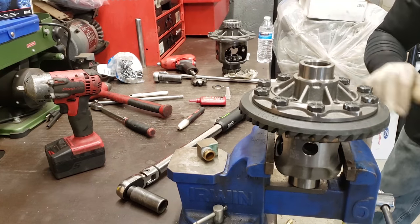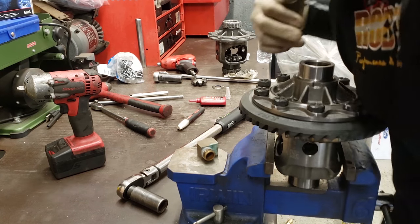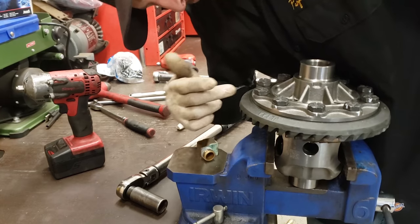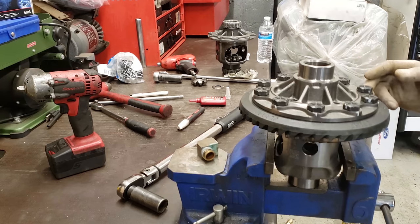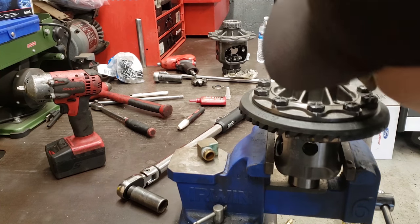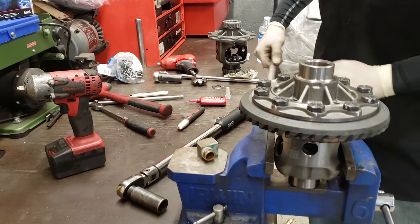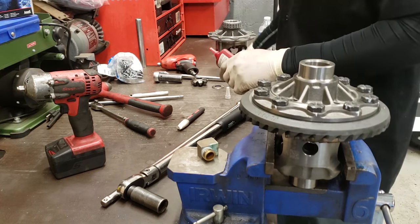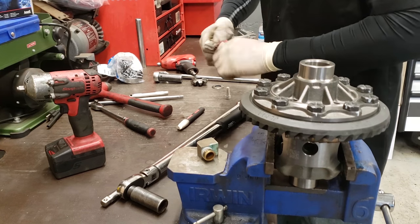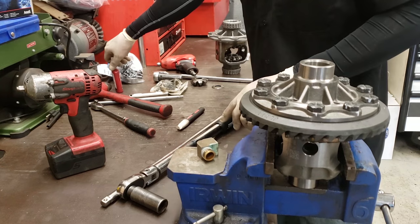Now you want to just double check all your white marks. Everybody should be 90 degrees. Okay, so everybody's done. Now you cannot re-90. That's what they call torque to yield bolts. So once you do it, that's it. All right, so now,